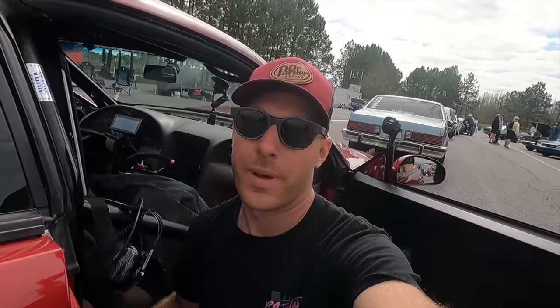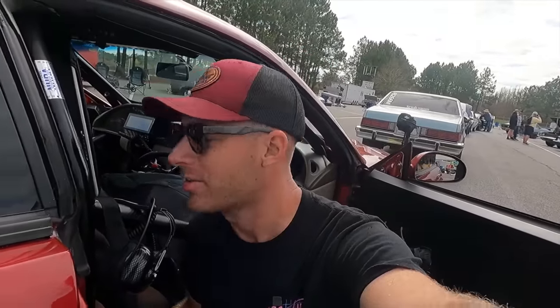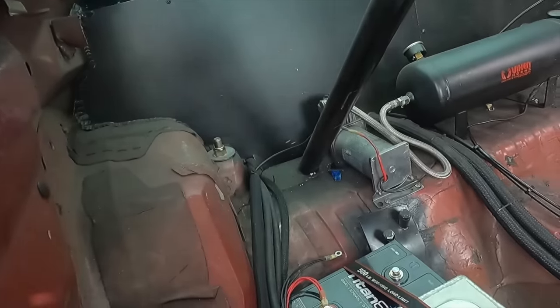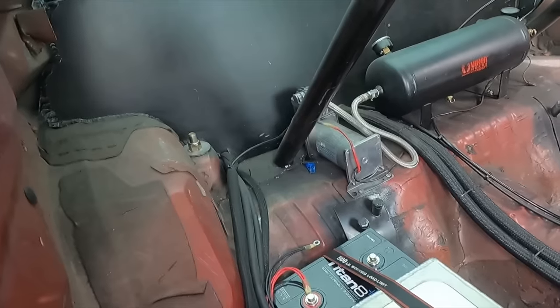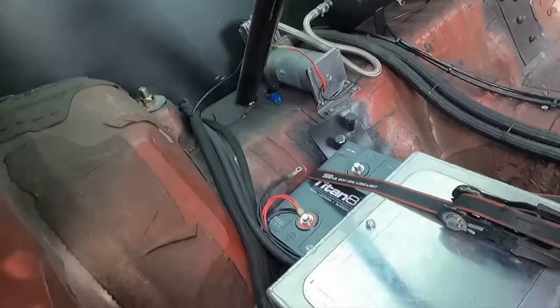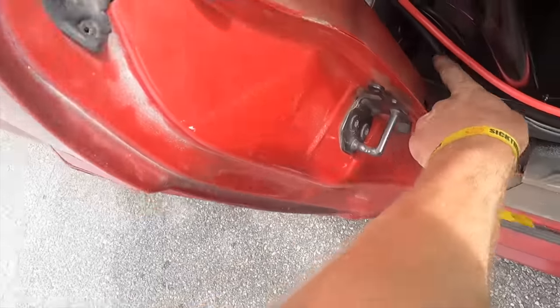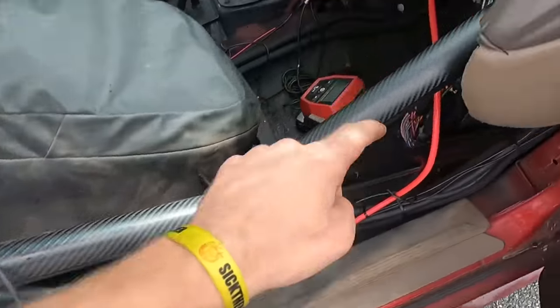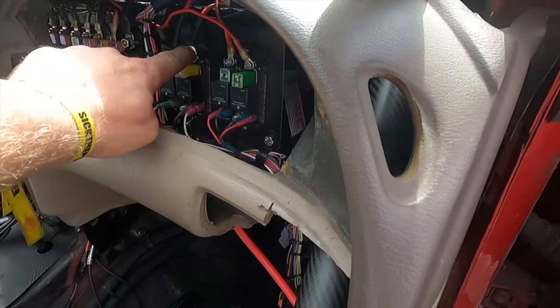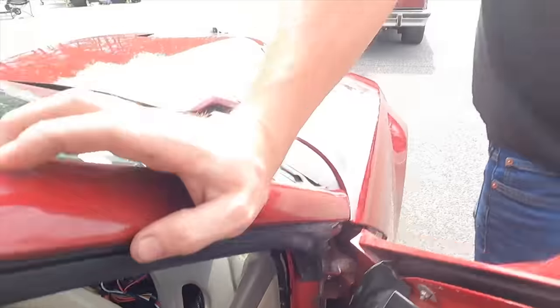We've made a little adjustment to our batteries. Shout out to XS Power, who is helping out the Cletus team. We snagged one of their new 14 volt batteries that they sent. We put it in parallel with our existing 12 volt battery because we're dropping so much voltage - this is a 14, this is a 12. The power goes to the power, the negative goes to the negative inside this box. And then we also ran a new power cord directly to the relays that powered the fuel pumps up front, and then these two go to a booster pump which then feeds the fuel pumps.